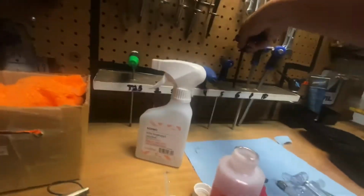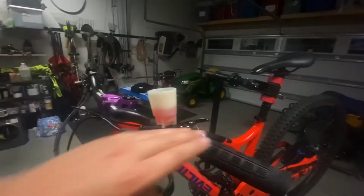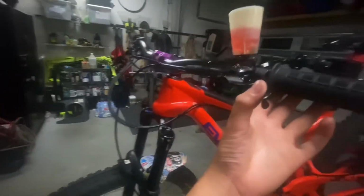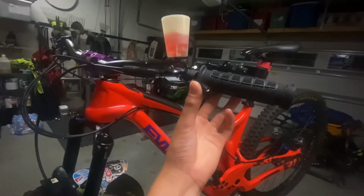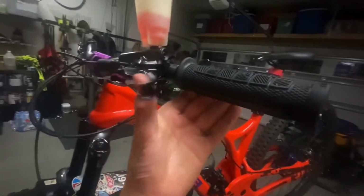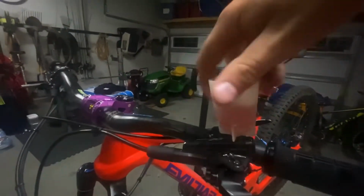And since we left that thing in the lever here, all we're gonna do is give her a few pulls. Get all that excess air out, as you can see on up here. We're gonna pull, and what I like to do is slow on the end, release, slow on the end, release, and that just makes it feel extra mint. And once you think you have those dialed, we can grab our little thing here, slide it in, unscrew that.